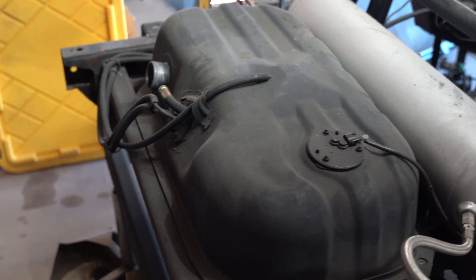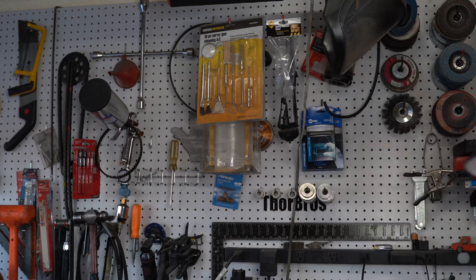So I asked myself: why spend the time to build this tank from scratch? It seems counterintuitive, but I think building the tank from scratch would actually take less time than modifying this tank to work — which would include removing the rubber coating so I can weld on it, completely cleaning out the fuel so it doesn't explode when I weld on it, removing, rebuilding, and replacing the top so the Eclipse pump will attach, and filling the existing holes.